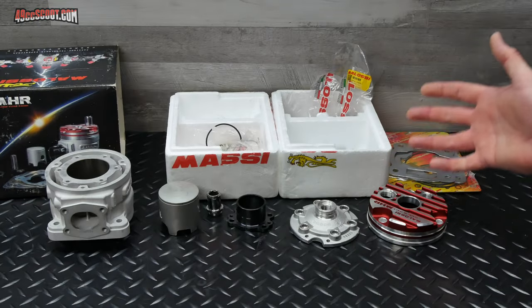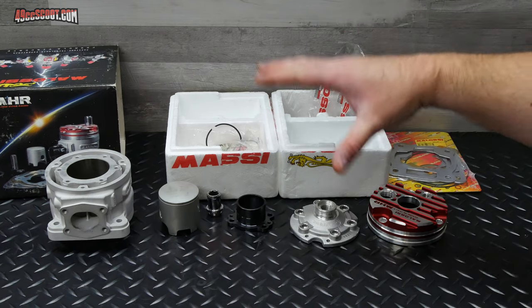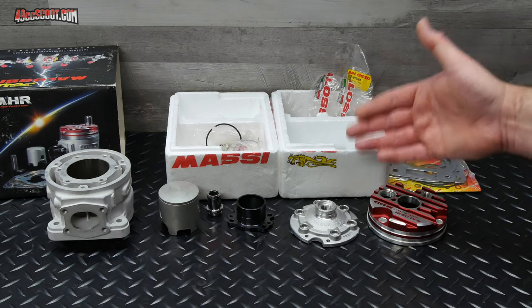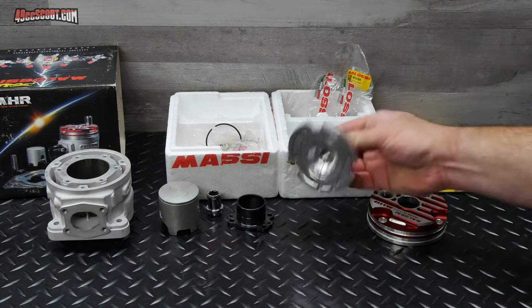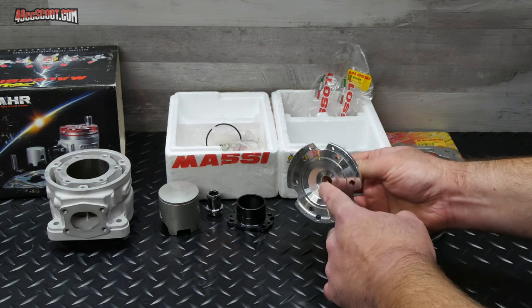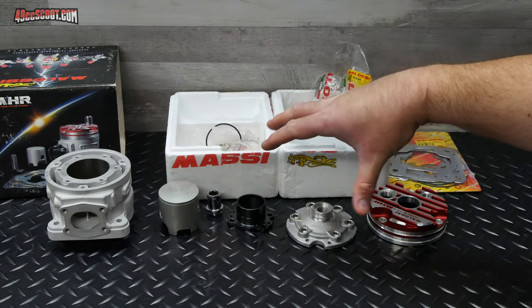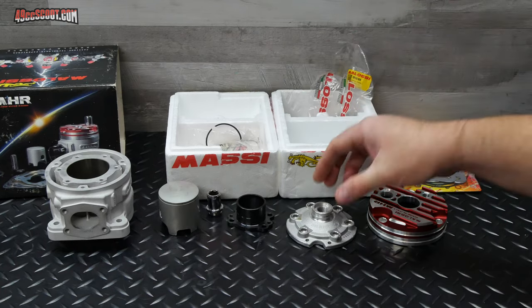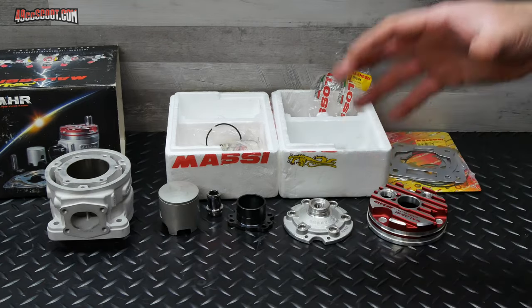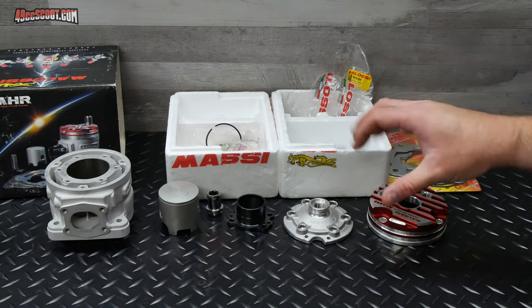While we're looking at all these pretty parts here, I want to say, before you get started with anything, you should do a thorough inspection of everything when you unbox it. I did an unboxing video, and if you watch that, you've already seen this, but I found a whole lot of burrs on this cylinder head. Some people have found little chunks of metal left over from threading. There's all sorts of things that could be wrong here, hopefully not, but a lot of this is just tiny little stuff where you just deburr it and you'll never have to worry about it, but definitely do that. That will reduce your likelihood of having any kind of foreign debris, any sort of metal inside your engine, which obviously you don't want.